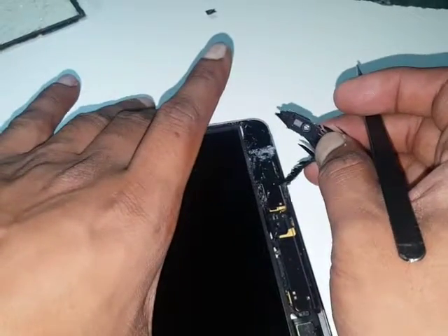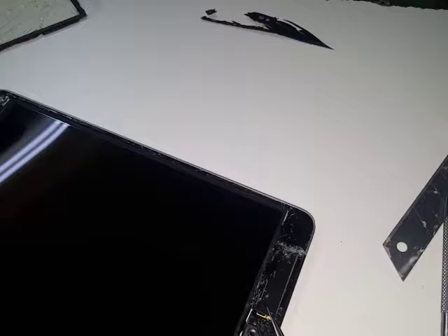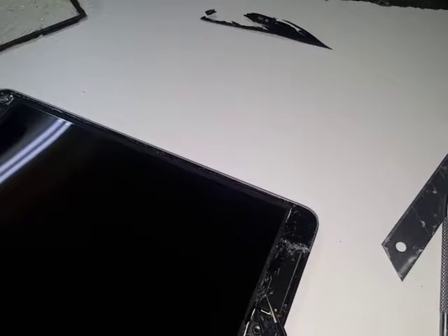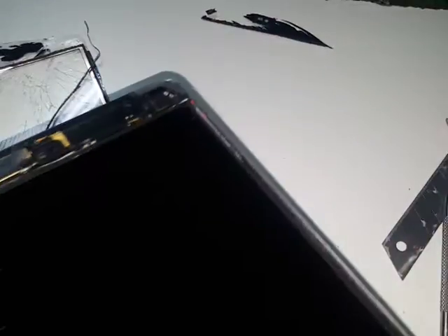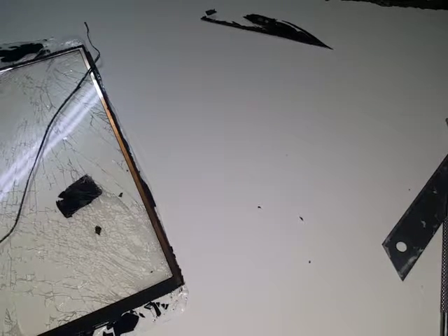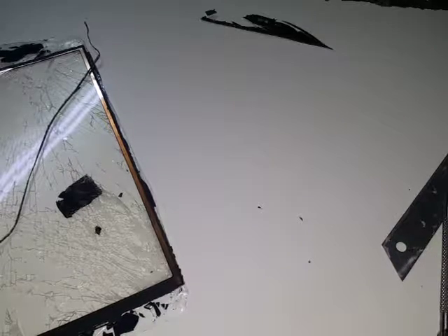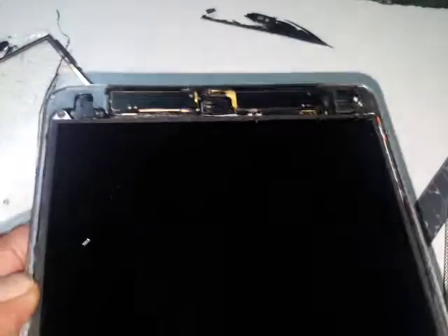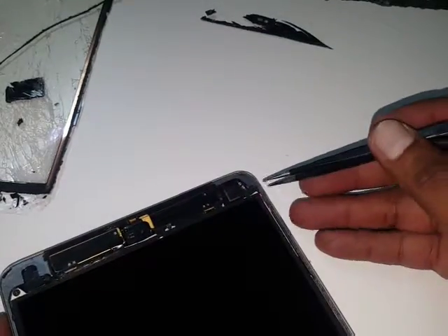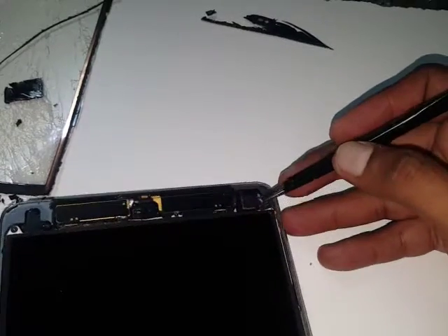Let me remove the front camera glass and put it aside with the magnet. I'll keep removing small pieces until it's fully clean. The main objective was to remove the touch without any additional damage to these components — that's the back camera, and those look like aerials. Don't touch the LCD — that is the most important thing.